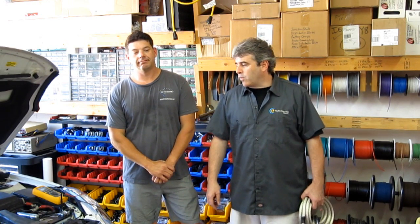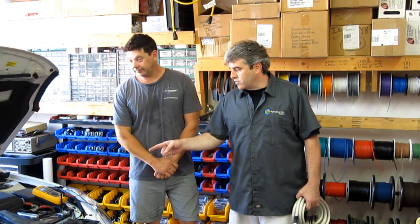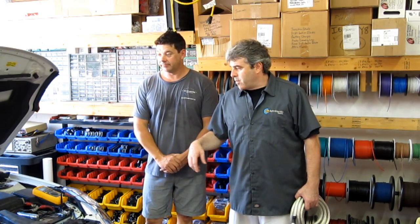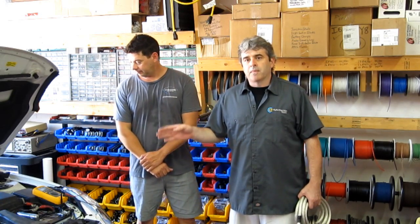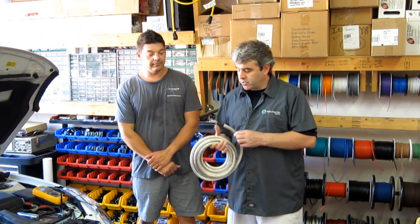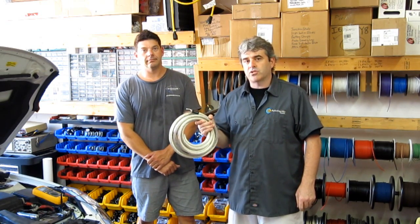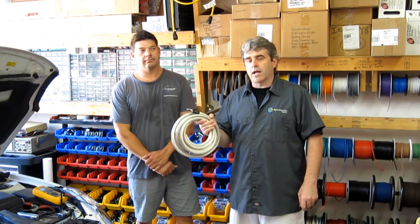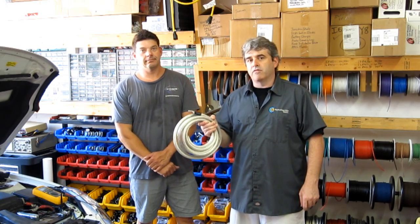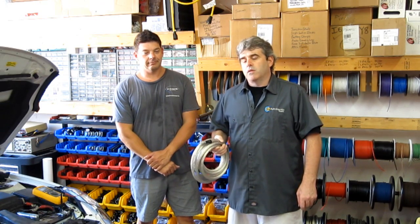What we've got is one of our CE Auto Electric Supply's Big 3 kits installed in this vehicle, and we're going to measure the voltage drop between the battery negative and the amplifier distribution blocks as that is. Then we're going to disconnect that and substitute this 15-foot length of full-specification oxygen-free copper 1/0 cable in the place of the vehicle chassis and see which one has lower voltage drop.